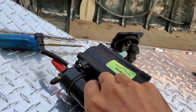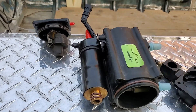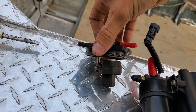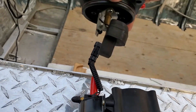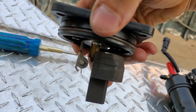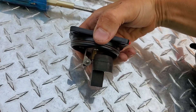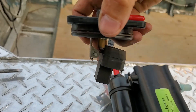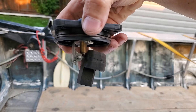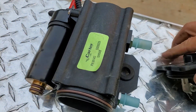This was the one that broke. This piece here goes on the bottom, and at the top there's a float. The way a float works — there's a little cylinder in the middle that goes up and down. The piece actually floats in the gasoline. When it's up, it closes the little valve and fuel can't get in. When it's down, it lets the fuel in. So this just regulates the fuel level inside the tank.